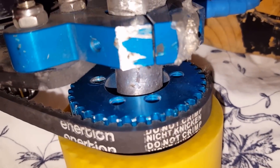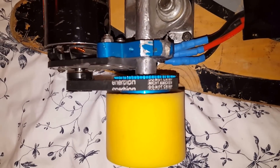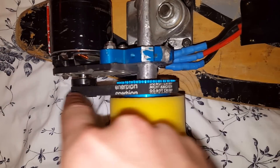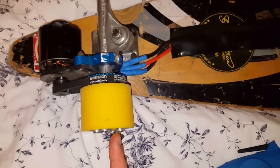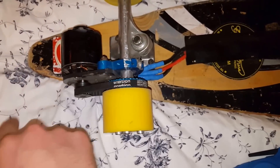One little trick here is that I adjusted the depth of the wheel, because not all skateboard wheels are made equal or of the exact same dimensions. So in order to get the wheel outward a little bit and have it aligned properly, I put in a couple of washers between the bearing and the axle itself, in order for it to be aligned properly with the engine gear.